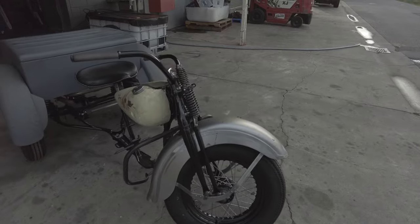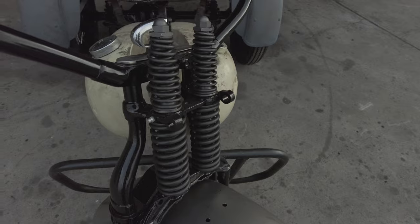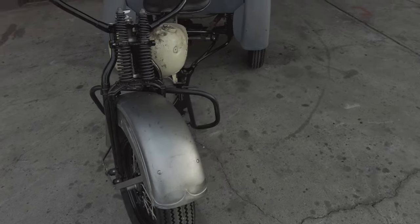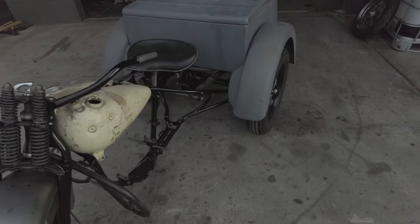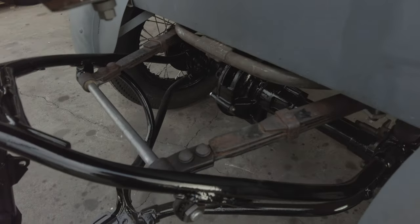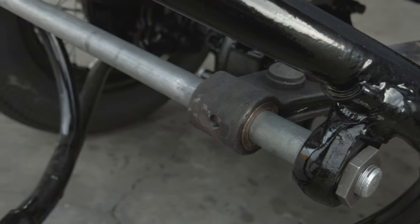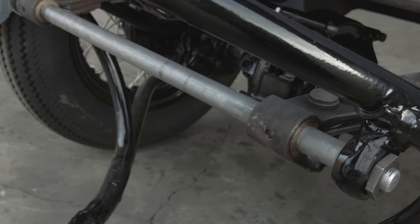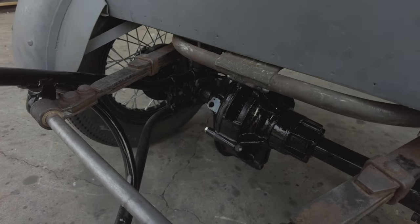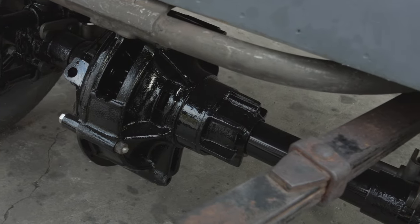Next step from here is to get the box fully mounted properly and in place and then get ready for paint. Front end rebuilt, trying to go the correct finishes where I can — Parkerized, CAD black, and I'm going to go flight red with the tinware. These leaf springs have been rebuilt with new bushes. Still got to Parkerize the tie rod and finish off all the little bits and pieces under here, so quite a lot of work in these compared to a solo model.